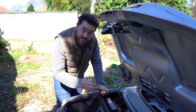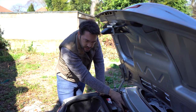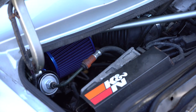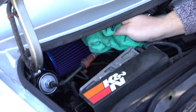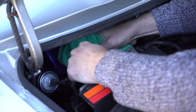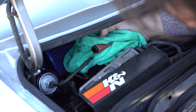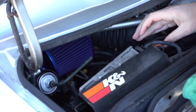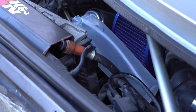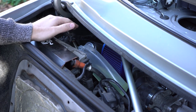I'm going to test to see if there's any fuel getting through at least most of the system. I'm going to disconnect the fuel line that comes out of the fuel filter - it's a convenient place to do it - and try to eliminate that as being a problem. I'll put a bottle around the end so that when I turn it over, if it's collecting fuel I'll be able to see it. It's wet in there, so at least some fuel has gotten through - that's a positive sign. I'm not going to turn the engine over because it's clearly just dumped a load of fuel in there. At least the fuel pump's fine, the filter's the right way around, and the lines are okay. So now I'm going to check for spark.